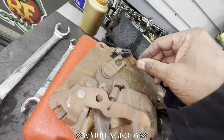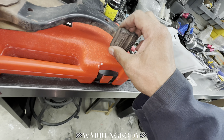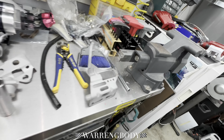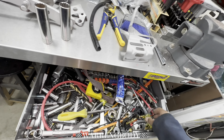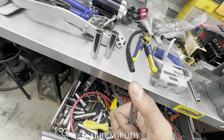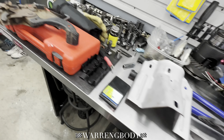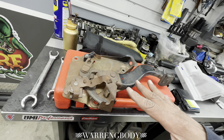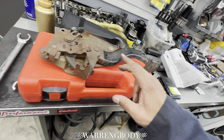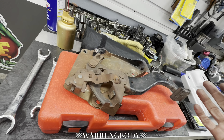I'm going to clean all this up, clean everything up. This area we will paint. I got to figure out how to get this old dinosaur off of here — just stuck on there. That's where these guys come in big handy — these right here. These are wood chisels. I get them from Harbor Freight. They are sharp as hell right here on the edge. If I got to clean something up, this just digs into it real nice — it peels off like a banana. That'll get that off no problem. We'll sandblast this up, exercise the hell out of it — all the moving parts. We'll sandblast all of this, get this off, paint all of this up, get a new shoe for it, and reinstall it.